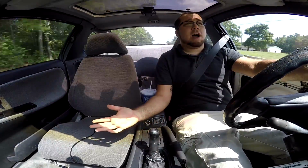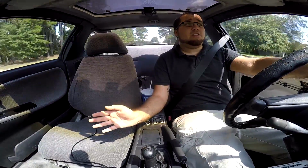Last night, I drove it around a couple times off camera. I came home, cleared the codes, drove it again, and checked the codes, and I got a 55, which is all good. So there are no more codes. That weird California only cars code disappeared. I don't know where it went. I don't really care. So the coolant temp sensor code is gone. That was replaced with a brand new one, and my knock sensor code has disappeared thanks to my resistor pack.